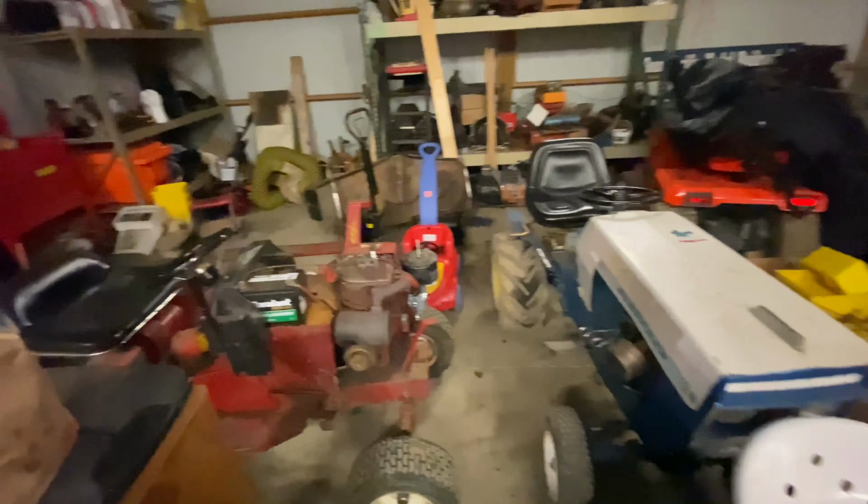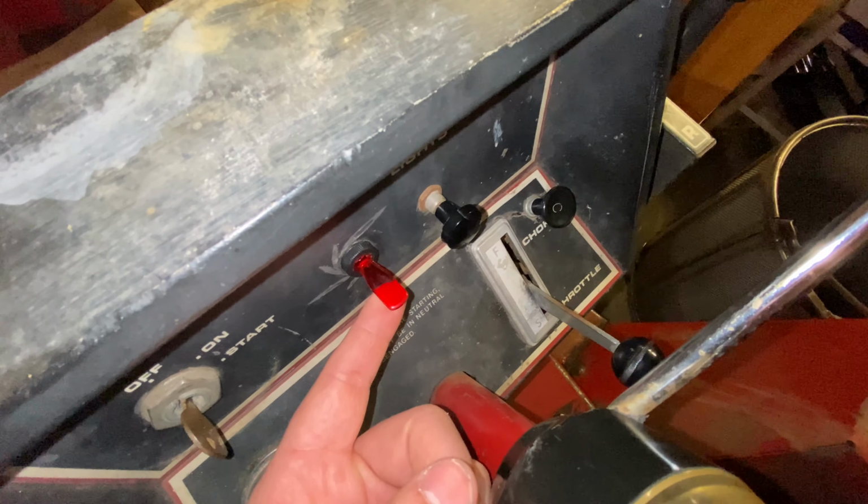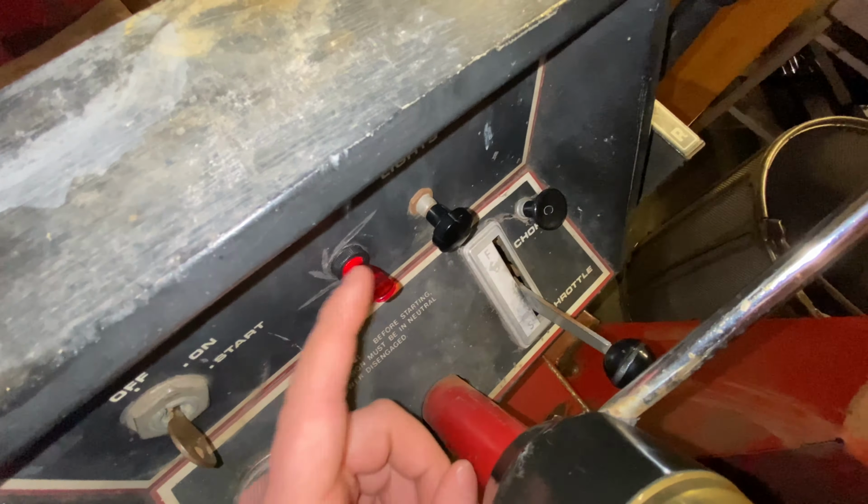So far I have put on a brand new carburetor and a brand new ignition system. I converted it to the electronic ignition coil versus a standard points coil and condenser, so those are now gone. New carburetor, obviously. I did an electric fuel pump, and I also did a little something here so I didn't have to drill another hole in the dash. I just stuck an inline fuse in here, and where the fuse usually is is now my fuel pump switch. As you can also see, my switch lights up red, which is pretty neat.